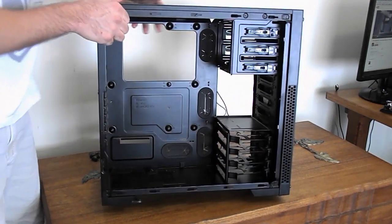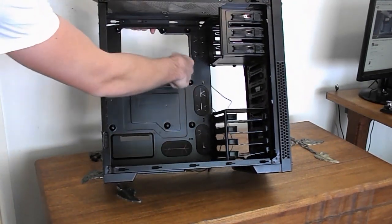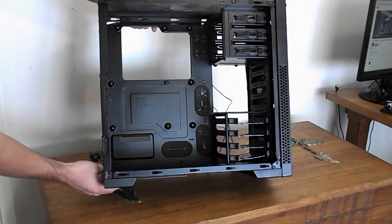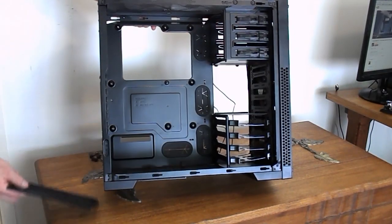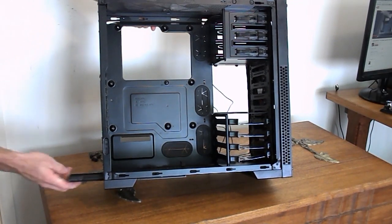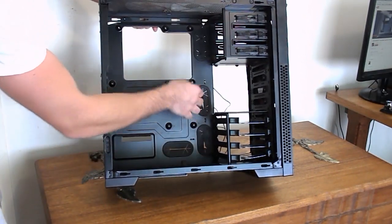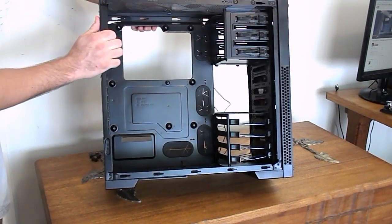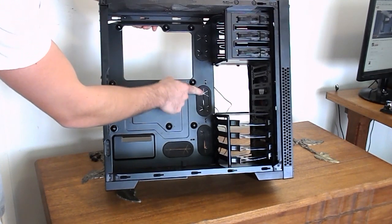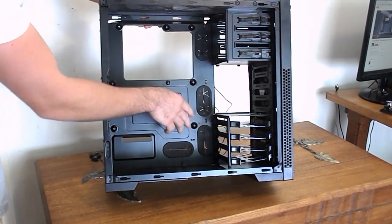Big CPU cutout helps, like that. The fan filter down the bottom, most cases will have that when you turn your power supply upside down, and it just draws nice air. Now what I'm pointing to there are just routing holes, for your cables. The 300R doesn't come with those grommets standard. I actually got them separate, but that's the Corsair case, but if you have a nice case, they'll probably have some of them.